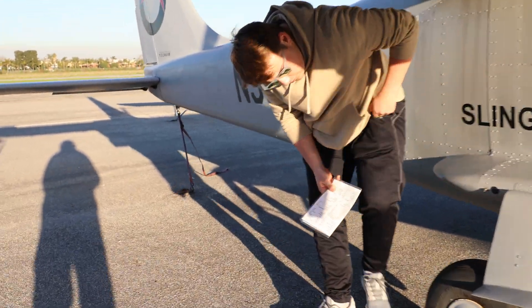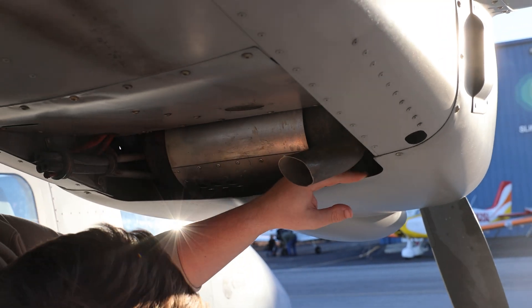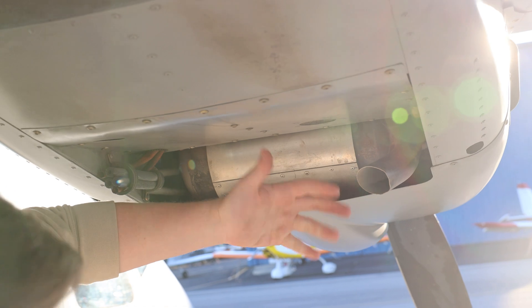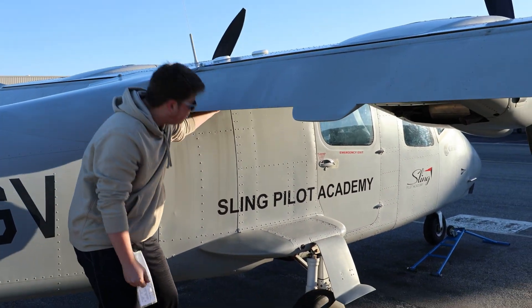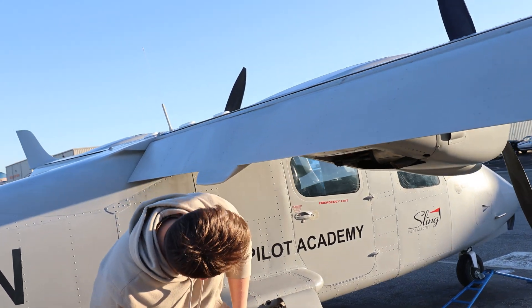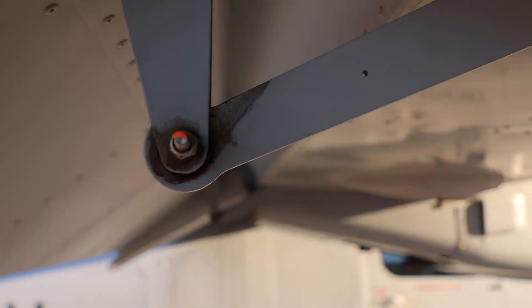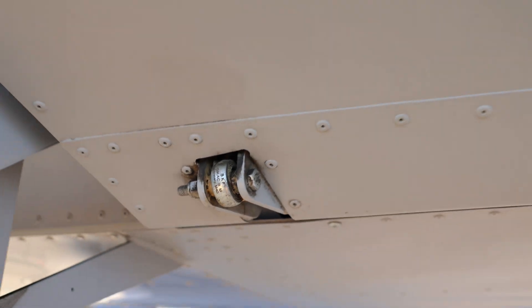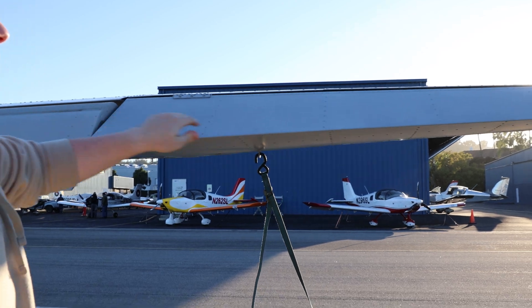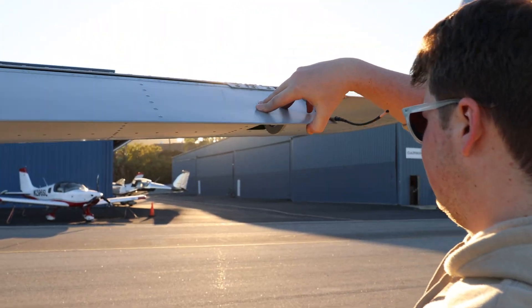We're going to look up at the engine again. It's really limited to what you can see inside, but we're looking for the coolant tank and checking for anything that looks like oil leakage. Looks like we've got our coolant — everything's set up in there. Next, we're going to go back to our flap and look at all of our bolts and hinges, looking for that thread lock. We've got bolt one, two, and finally our third at the end. Then we'll come over to the aileron and check the eye bolt that holds it on. We'll check our full, free movement — no resistance, nothing holding us back. And up top, we're going to look at all the hinges and make sure those little pins are up there holding it on. We've got one and two there — that looks good.